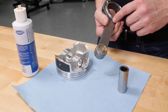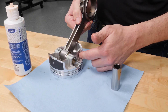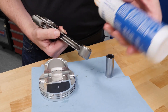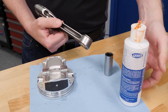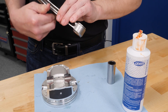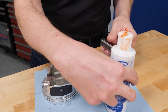I've labeled this with 1F, which I use as '1 forward,' and I've got 1B, which is '1 backward,' meaning that if I load this thing in here, the valve reliefs will be in the right place, and my chamfer on the connecting rod will fit the fillet of my crankshaft. I'm going to go ahead and use a little bit of assembly lube here — this is going to go in there and it is never going to leave as long as that engine is sitting there until you get this thing running. I'm also going to lube up the wrist pin at the same time, since assembly lube is nearly free.